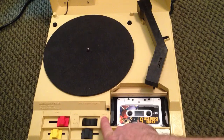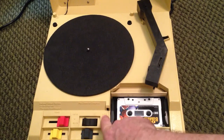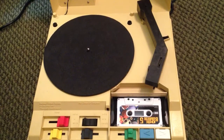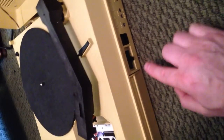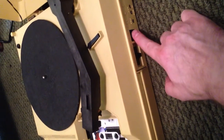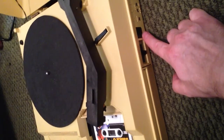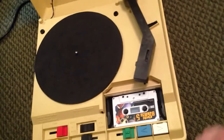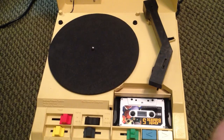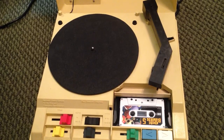You have 15/16 inches per second as well as 1-7/8 inches per second, which is standard cassette speed. Over here on the side you have some controls for the cassette deck — you have auto and manual change for the sides, and a button that allows you to change the side. So essentially you can put in a National Library Service cassette that plays at half speed of normal cassettes, and it will play the entire tape — both sides, all four tracks — completely automatically without you having to touch the unit.